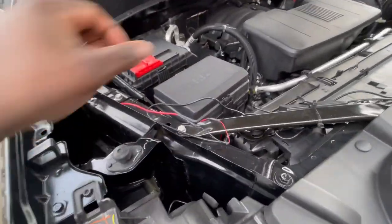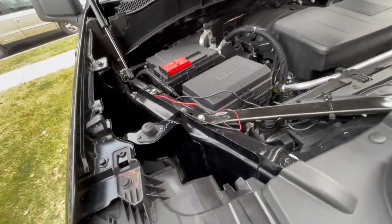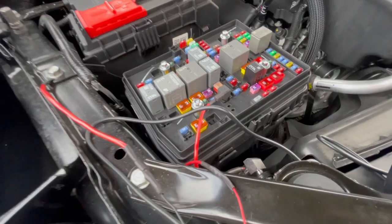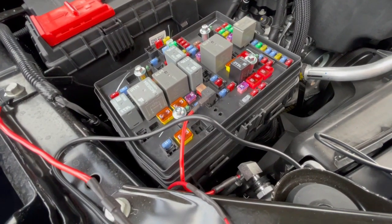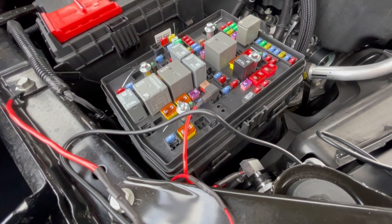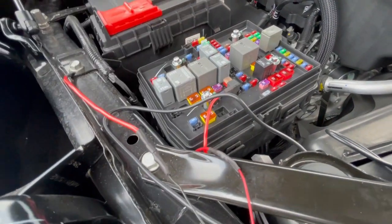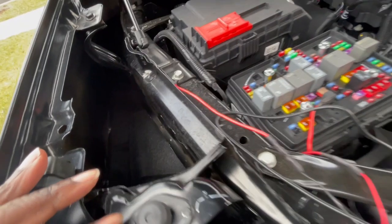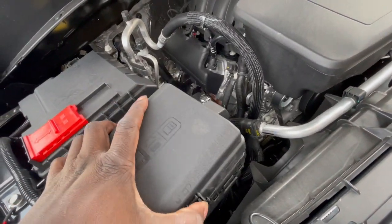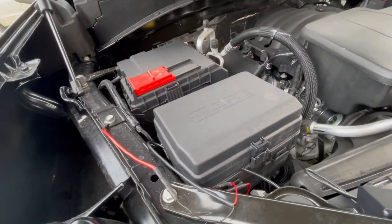To finish the wiring, instead of running it to the battery or adding an interior switch like I originally wanted, I went to NAPA and bought a mini fuse holder. I've got it hooked up right there with a 5-amp fuse, with my ground right there, so the lights don't come on until that fuse circuit is initiated. That's the way we've got it going.